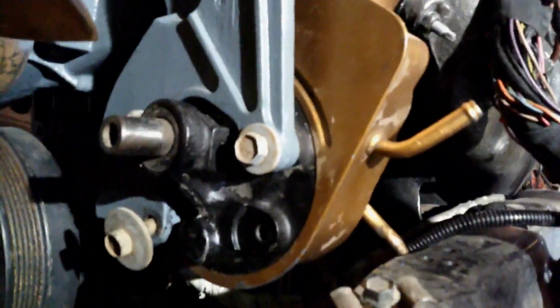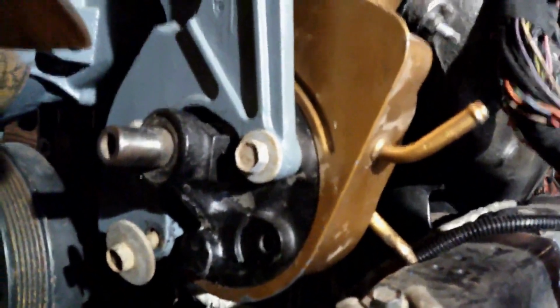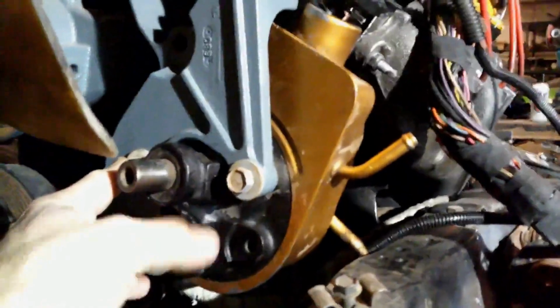In a previous short form video, I had mistakenly determined that the popular Saginaw pump did not fit this included bracket. This led me to believe that I had to use the included ZF pump. I'm now discovering that the 3-bolt pattern does match 3 of the bolt holes in the Saginaw pump. Using an extra long bolt, I can now see that we have a clearance issue keeping the pump from resting in its proper position. Here you can see contact at the filler neck and at the reservoir flange.